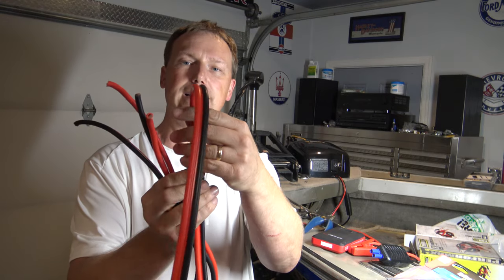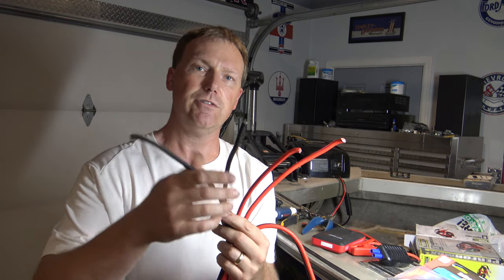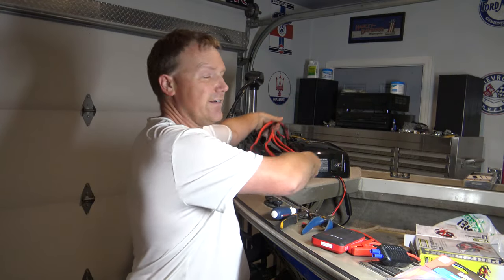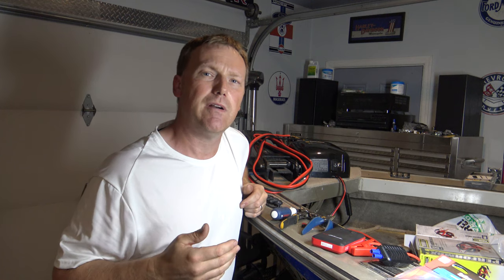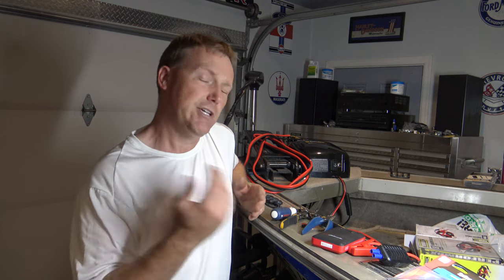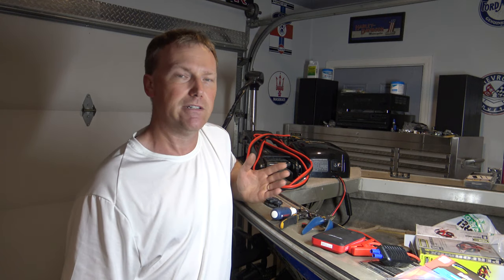It's already kind of together, so it's probably going to match just about anything in your boat. It's nice and supple so you can bend it around corners and snake it through your boat depending on where you're going to move your wiring to. And they're only like seven, eight bucks. If you go to the electrical department and buy wire off a spool, you're probably going to pay $25 for that kind of wire. So the cheapest way to get your wire — get a set of booster cables, cut the ends off, good to go.